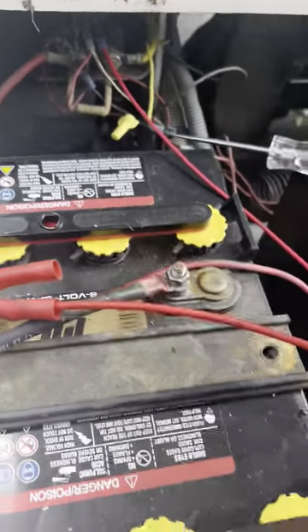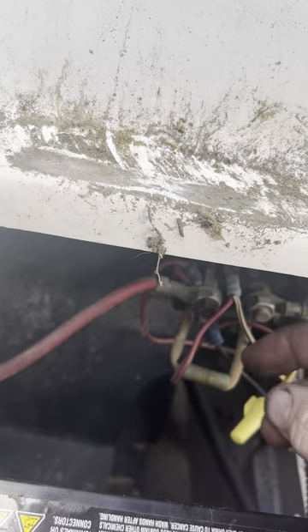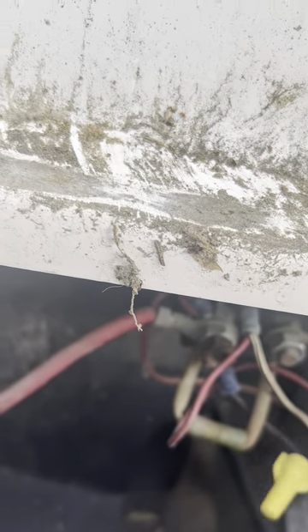What we're going to do — the yellow wire, the yellow wire on your solenoid is the ground. The red wire on your solenoid is your hot from the key switch and the pedal switch. This is your ground wire here.